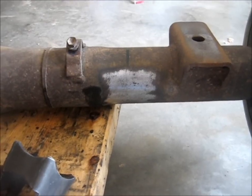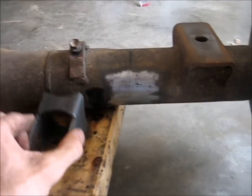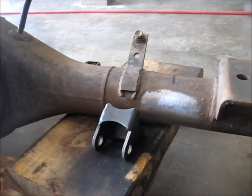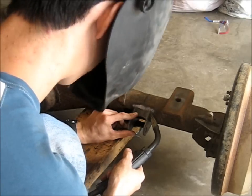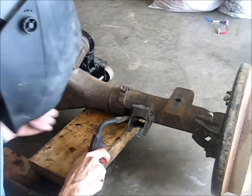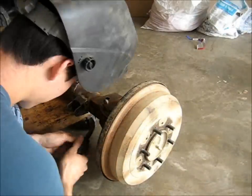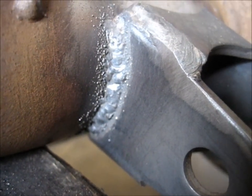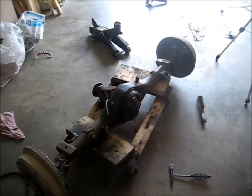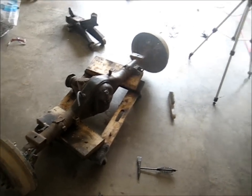Got myself a 4Runner axle out. I ground down the axle just to get it down to bare metal, and I've measured up where I want the shock mount tabs to be — got the same thing going on on both sides. We're ready to tack them on to the axle. The welds are done — that's probably the best-looking one, and they're all about the same. I wire-wheeled it, then washed it with soap and water and wiped it down with a damp rag. We'll wheel this out into the sun and let it dry while we mess with the springs.